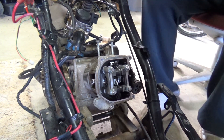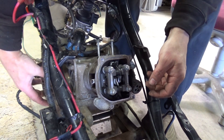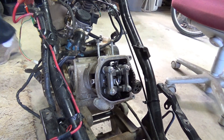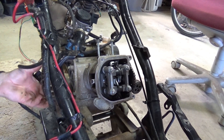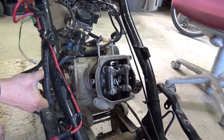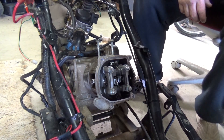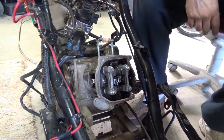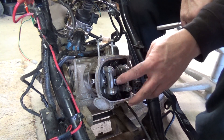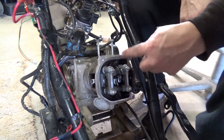It's a 10 mil. I want to put this back on top dead center. The exhaust is open, intake's open — come back up and according to the flywheel, right there should be top dead center. The cam is still lined up so that hasn't changed any. In order to get the head off you've got to take the rocker arm assembly off, then get the cam off, then you can remove the head.